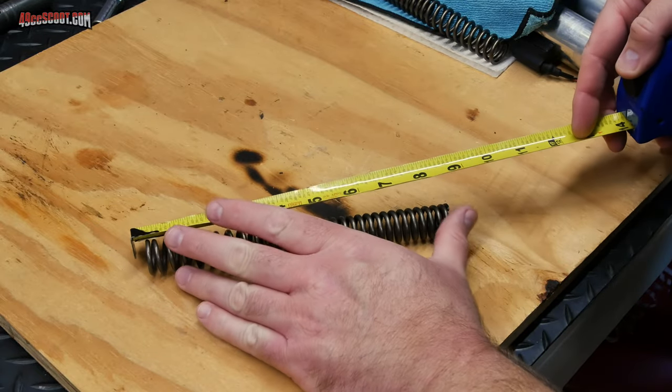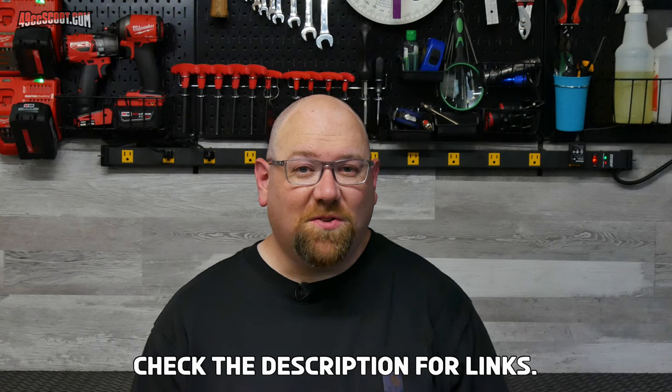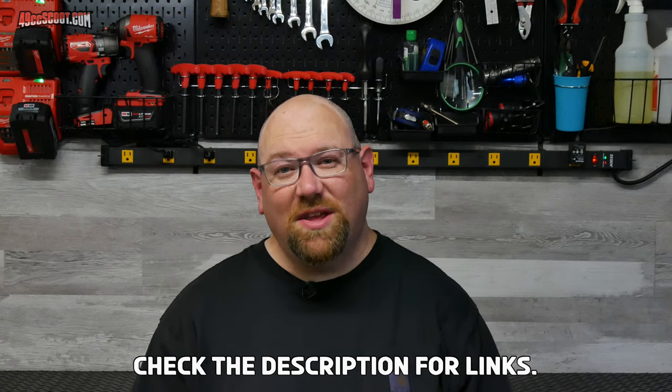Check the description of this video for a more in-depth and technically accurate explanation. I should also mention that many will tell you replacing the fork springs with springs having the desired properties would be the best way to modify the front suspension. I don't necessarily disagree with that, but finding pre-made springs to fit both my needs and my small Chinese scooter is not so simple. I'm sure I could have something made, but that could be expensive and cutting these is not. I measured the spring lengths and they came out to about 8.25 inches or 210 millimeters. I went with the much less scientific approach of deciding to cut about 20 millimeters off, or a little over 3/4 of an inch, and we'll just see what happens.